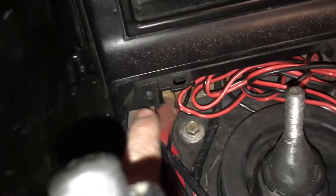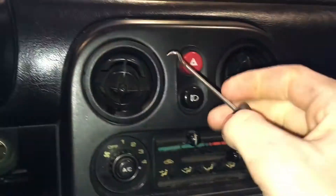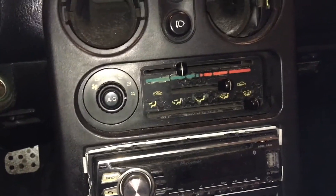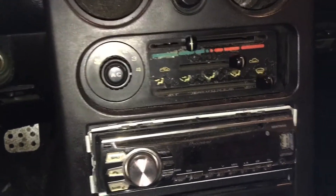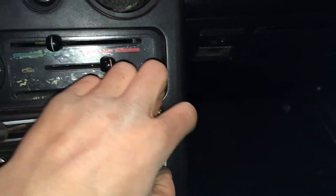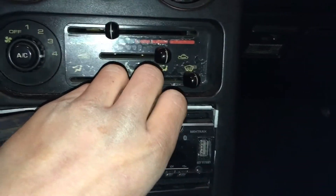For the tombstone, usually you'll have a screw here. For these vents, you want to get in behind and pop them out. For the screws on the tombstones — if you look straight up, that's where they're hidden, one there and one there. A little trick not very many people know: if you get a very skinny flathead screwdriver or a pick and slide it in over top of the radio and then pull, it'll come out. There are little clips that hold it, and this pushes the clips up and out of the way.